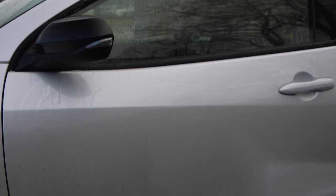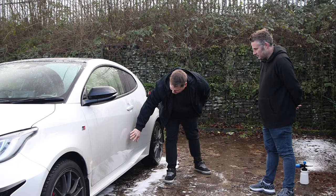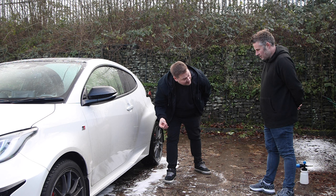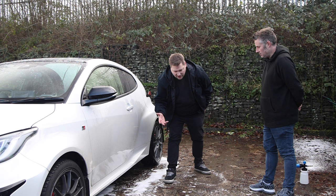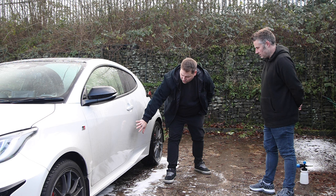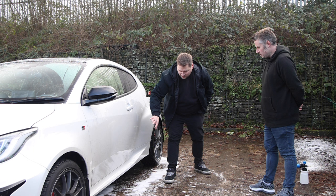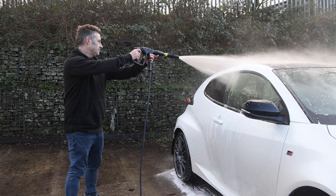Let's give it a rinse. The car is PPF'd so I can get away with a contact rinse style. What you have to respect is that at this stage it is no longer abrasive - it is effectively a sludge. I was also careful not to go too high powered with the pressure washer to show that it's the chemicals cleaning, not just the pure power of the washer. I've got a sludge there now - happy to do my contact wash with a snow foam that has no chemicals that will really interfere with the LSP.